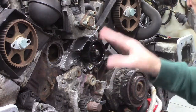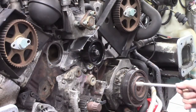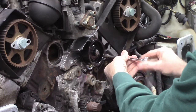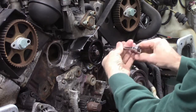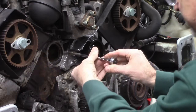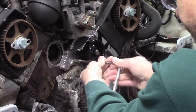And so now it's very important to torque this thing down. This has got water in there. It's a water seal. It's got a gasket. It's kind of a wide area. And you don't want to just go down here and tighten them down like you're tightening up anything. So I'm going to get them all kind of snug, and I'm going to go around this thing two or three times. I mean, you don't want a leak here. You get this car all back together again, you start it up, and this thing starts leaking coolant, it's not going to be fun.